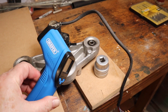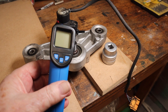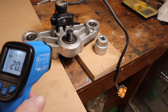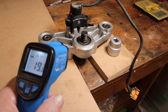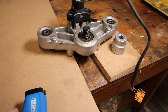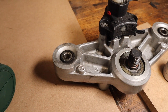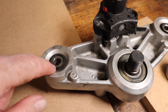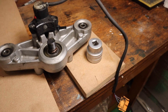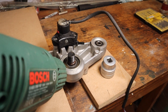My digital infrared thermometer has come - it's only a very basic one but it's quite easy. If I just go like that, you can see the metal at the moment is 19 degrees and I've got to get it to 100. I'm going to try my heat gun as opposed to a flame, because these are bushes here in a plastic rubbery surround so I don't want to use a flame. I'll carry on but it's noisy so I'll switch off.